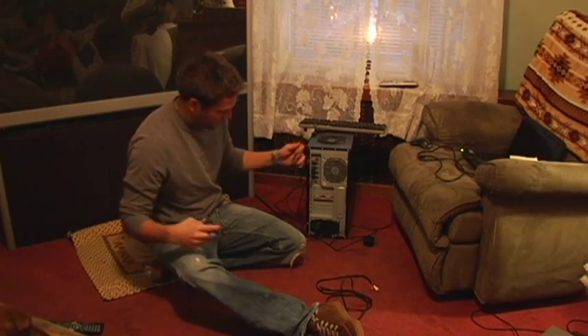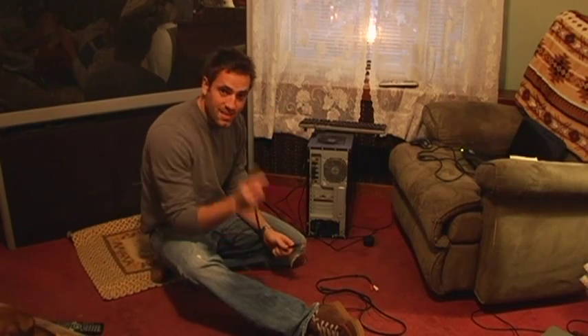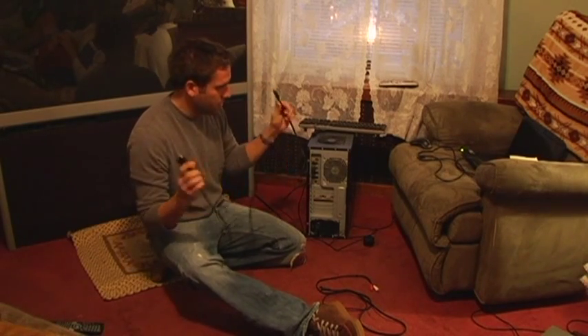Hi, I'm Gary Malek and in this video I'm going to show you how to hook your computer's sound and video up to a television. I'm going to recommend that you use a video card that has DVI outputs. I have a DVI to HDMI adapter because I have a high definition television here, and that's how I'm going to hook it up.